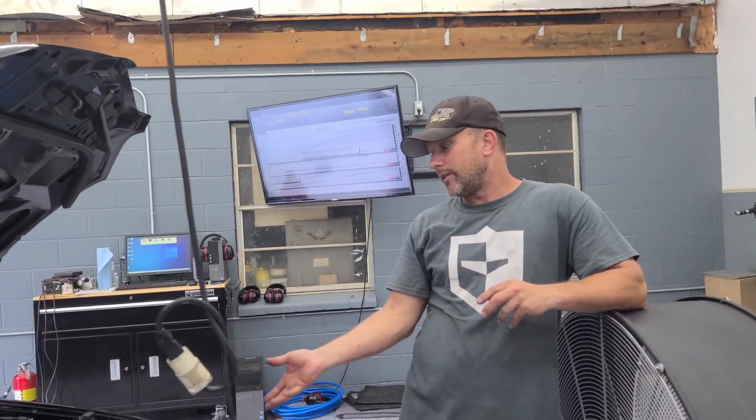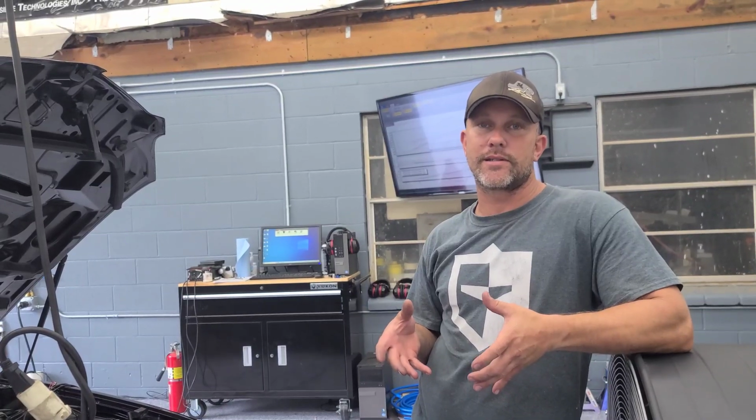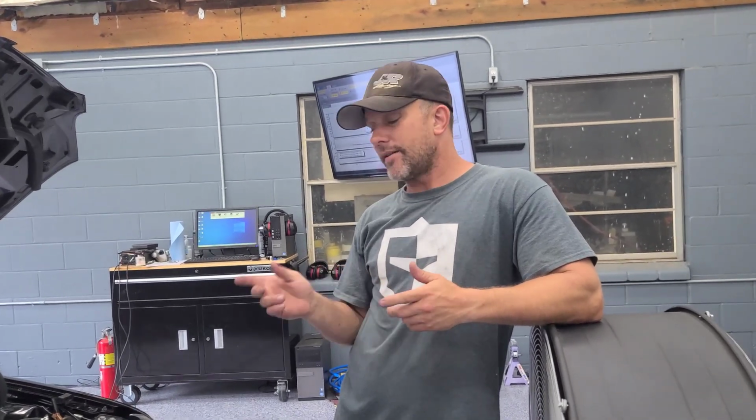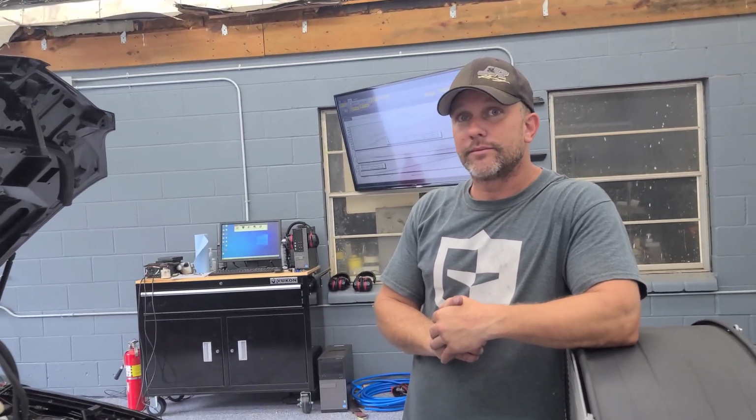That's right. He went from a stock Procharger lower, 7-inch lower, to our ATI setup with a 7.8, which is as small of a lower as you can buy. And I think he had what, a 4 upper? I think 4-inch upper. So yeah, a 7.8 is a stock LSA lower size. So with that, probably more boost in this setup, right? 7.8 with a 4? Yeah. Because you said the bottom makes a bigger difference. Bottom is less difference. Oh, less difference.